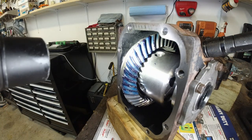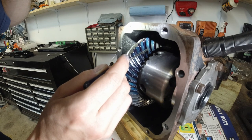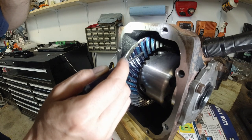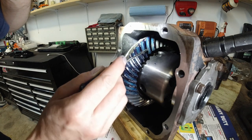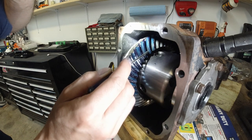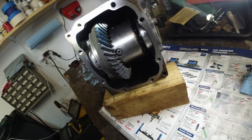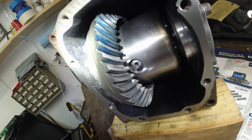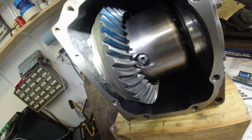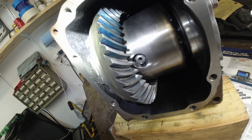Okay, this time they're a bit lower. Also in the middle, but just lower. Right here, here. When I say in the middle, I don't mean on the edge of the tooth or too far in, just on the lower part of the tooth, but still in the middle. Going forward, it's not ideal, but like I mentioned before, it's not on the edge of the teeth or too far in, it's right in the middle, it's just on the lower part of it.